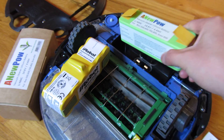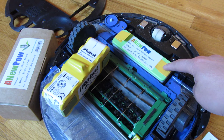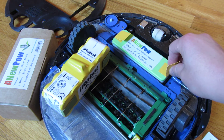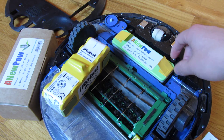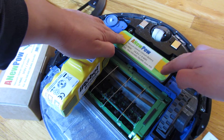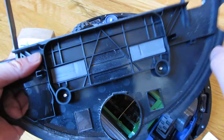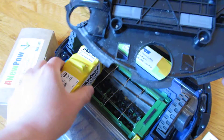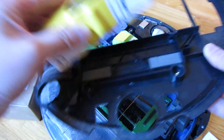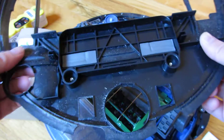These lithium batteries are also a tighter fit. Unlike what you might read in Amazon comments, you don't need to put some type of paper clip or anything to hold it in place or worry that the contacts don't match. From the two that I bought, they fit perfectly. But it is a tighter fit. The reason why it's a tighter fit is if you look at the cover, there's this ring here — it's actually tighter. For the normal battery it sort of just fits and there's some give to it, whereas with this lithium battery it actually fits kind of perfectly up here.